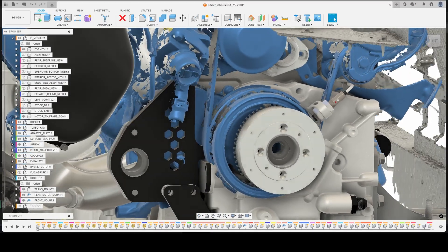We need to make one design departure from the factory layout: a reduced diameter drive pulley to limit the speed of the electric motor. The factory B38 spins to a pretty pathetic 6,400 RPM and we're going to be turning the rotary to a max of about 8,500 RPM. Reducing the drive pulley diameter has an added benefit — the starter generator will spin at its factory intended RPM, translating to a higher cranking speed of the 13B and hopefully getting it fired off a little bit quicker.